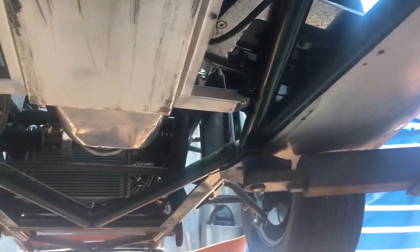Looks like I've got a little bit of oil coming off the back of the cover, but this thing only has 800 miles on it. Sometimes it takes a while for that flywheel seal to get the sharp edge burnished off.